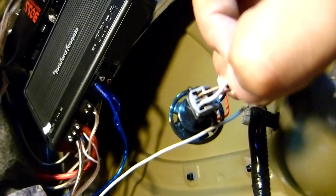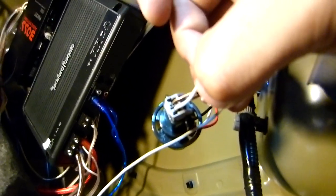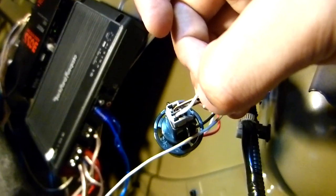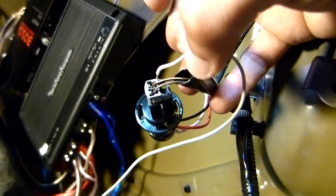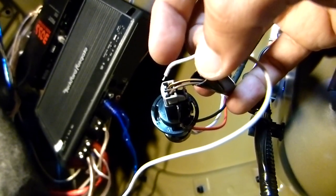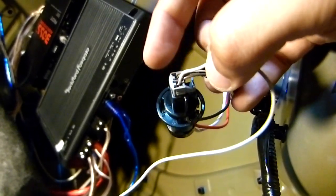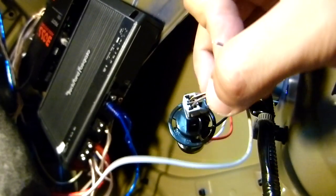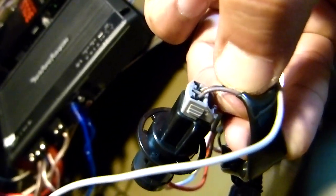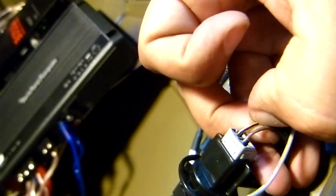Inside there, and I'm gonna put a tape because just in case I wanna remove the LED strip, I just remove it so I don't have to cut anything. I will just make this cable a little bit longer, not too long, and stick it there and put a tape around it, okay? So remember the cable with the black line, that's the ground, so connect it to the cable that doesn't have the black line, okay? So I'm gonna start connecting.